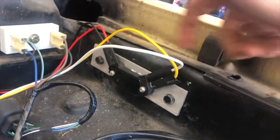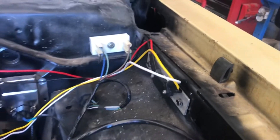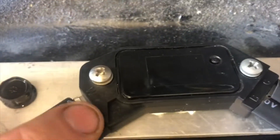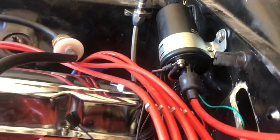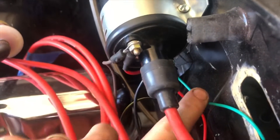What I did was took this and bolted it to a piece of aluminum as a heat sink — I got some dielectric grease on the backside of it. To make this really simple, I'm gonna show y'all how I ran the wires in case this can help somebody else out. So you got your terminals here and these are all marked — you got W and G, and then right here you got B and C. B is your battery. I have the brown wire on the coil coming off my harness, and then I have that red wire that goes from the coil — I ran it back and it goes to this top post right here. Then your black one goes to the negative side of the coil. There's a green wire also because that's for my tach, but here's the black wire — it's on that side of the coil.